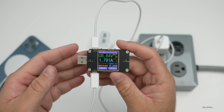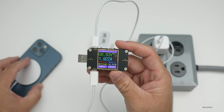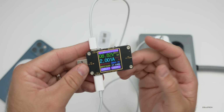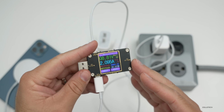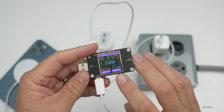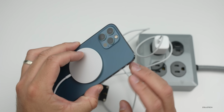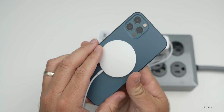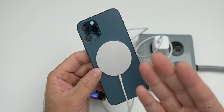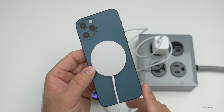Now, you won't stay there the entire time. It's limited if you have headphones connected. It'll be limited to 7.5 watts to comply with regulatory standards if anything's plugged into the Lightning port. Also, the charge will be slowed down if you get above 80% battery, and it will also slow itself down if it gets too hot to help preserve battery life over time. Now, they also have said with the iPhone 12 Mini, you won't get 15 watts, so you get a little bit slower than that.